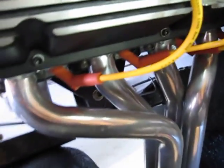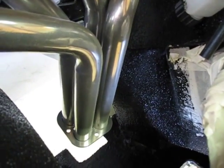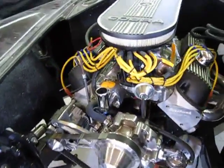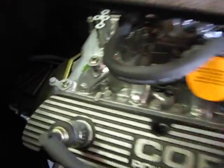Joel had already bent the brake lines and put them in place, then took them back out because he knew I was going to Rhino line. I've got those ready to go and fit. The master cylinders are over here — still taped up from when I did the Rhino lining. The headers have been installed and the holes have been cut. I have not installed the mufflers yet, and the engine has not been started.